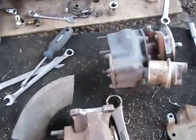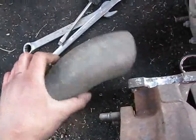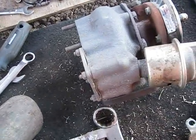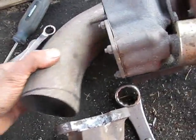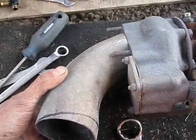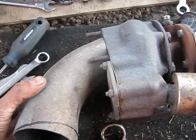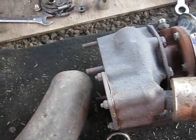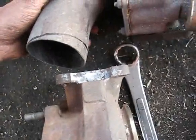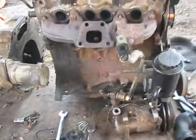I gotta cut that flat - that'll be freaking sweet, just awesome. I'm not sure if I have to have a blow-off valve; I'll do a whole bunch more reading, but I might have to have a blow-off valve after this turbo somewhere on here. I've got one I picked up off a Mercedes so it'll do the trick - I can tune it as well. That guy will go like that and then the CT26 will get bolted right underneath it. There's enough space on the motor to do it and it'll clear the starter.